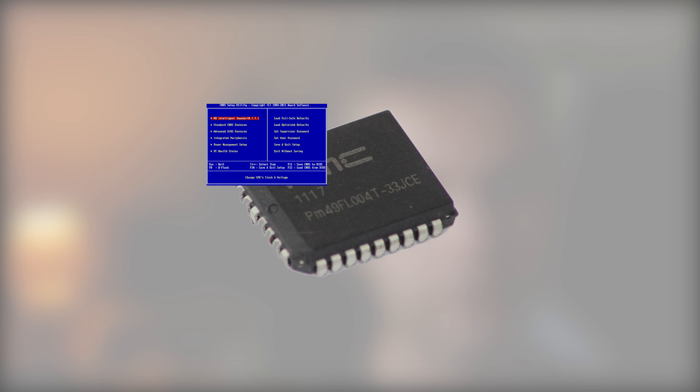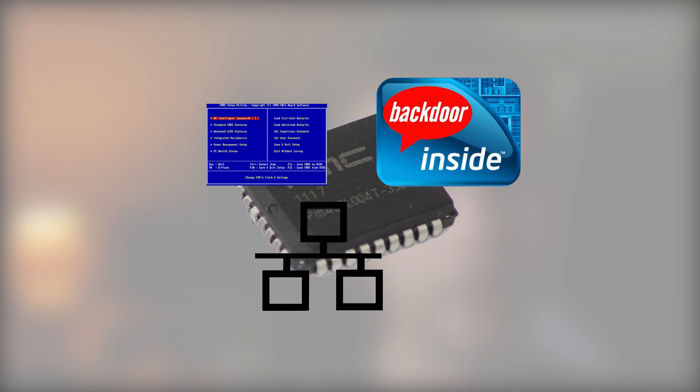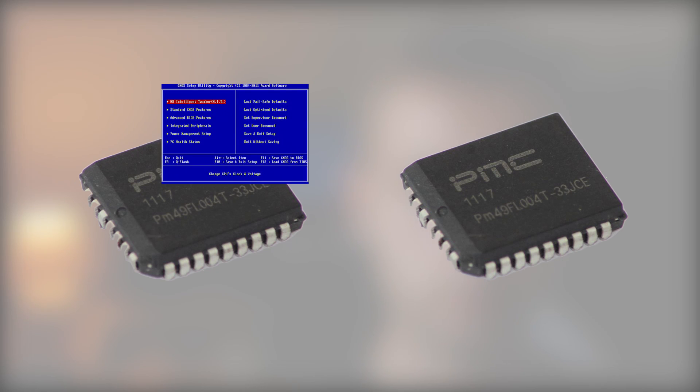So let's now talk about the process itself. In this video I want to focus on installing Coreboot on the X220 and X230, and although the process is pretty much similar there is one big difference, and that is the flash chips. Basically the X220 has one flash chip that has BIOS, Intel Management Engine, Ethernet firmware and everything on it, whereas the X230 has two flash chips — one for BIOS and one for everything else. At first glance this makes the process more difficult because now you have to flash two chips, but actually it only simplifies things. With X220, keeping everything on one chip means you'd have to build a custom image for each laptop, making pre-built images impossible, whereas with the X230 it is possible to install a pre-built image. So you might ask — where do I get those pre-built images? That's where the project called Skulls comes into play.